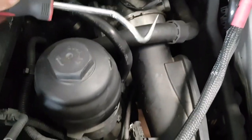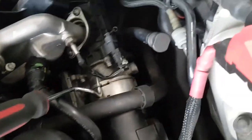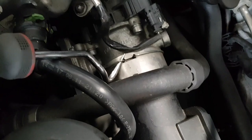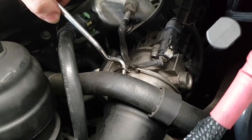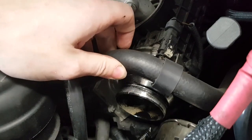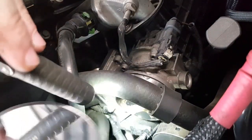I'm just taking a hook — or you could use a screwdriver or something like that. What we're doing is lifting this clip. You need to push the boost pipe on to make it become visible; if it's pulled back it won't let you pull the clip up. So push on, pull up, and pull the pipe off, then pull on the side. I'll take our mirror, and as you can see there is some oil in the bottom there.